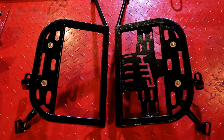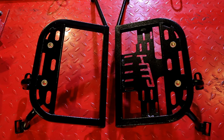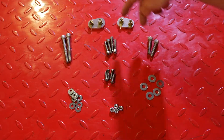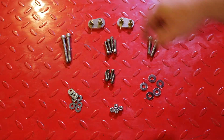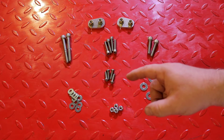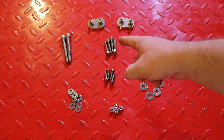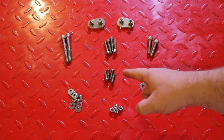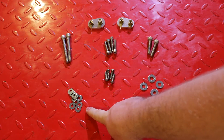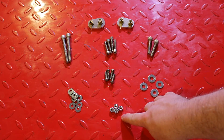For the hardware list for the Happy Trails SU racks, you should have both the left and right rack. You should also have the bumper, and for hardware you should have two turn signal inserts, two M8 by 35 bolts, two M8 by 65 bolts, four M6 by 30 bolts, four M6 by 20 bolts, four M8 washers, eight M6 washers, and four M6 nylock nuts.